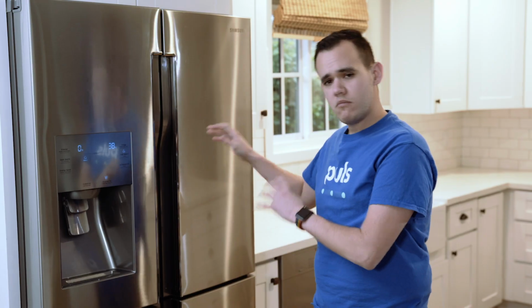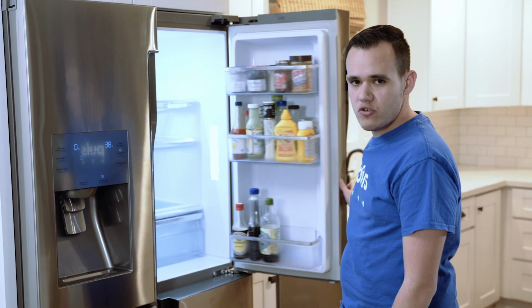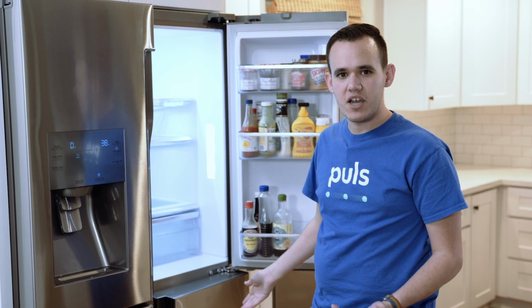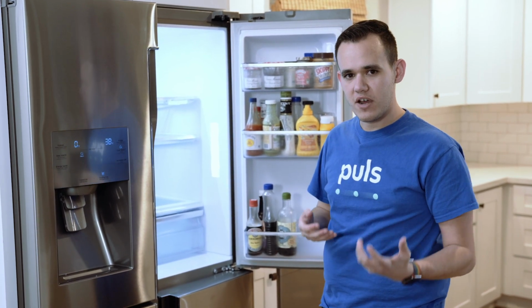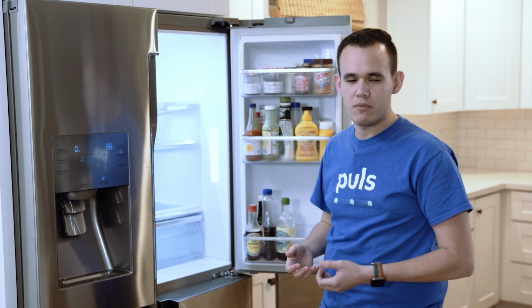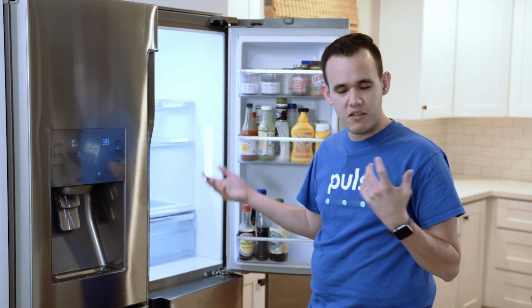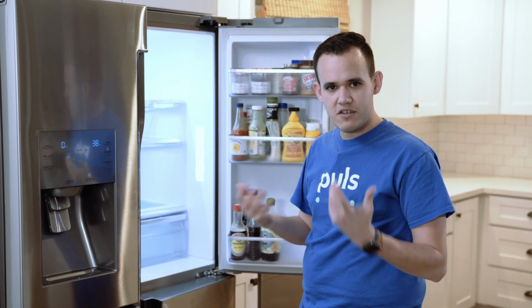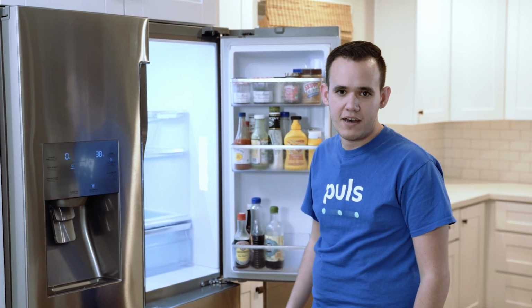would be to stand in front of the fridge, make sure it's really quiet, open the refrigerator door and listen for a couple of seconds. If it's really quiet, you can actually hear what's called the compressor kick on. It sounds like a little air compressor that your mom or dad might have used to blow up your air tires, or you might use at a gas station. That tells you that the system, the cooled air system, is actually fundamentally working and the cost of your repairs aren't going to be that high.